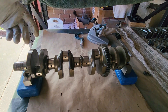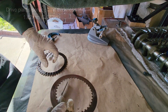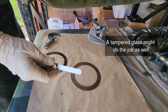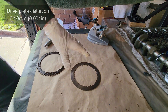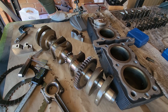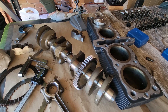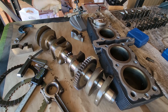I don't have the right equipment for the crankshaft runout — I'll have to take it to a specialist. The dry clutch plates also have a minimum thickness specification. Place each one on a flat machinist surface plate and use a feeler gauge; the maximum distortion allowed is 0.10 millimeters, which is typical for most motorcycles. I think I've covered everything for this engine — these are all the measurements you need when checking the engine of your Suzuki GSX 750/1100, 1988 to 1989 models.